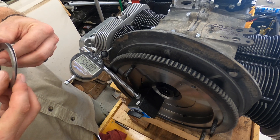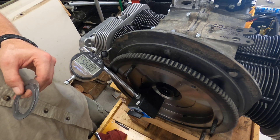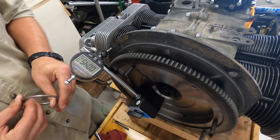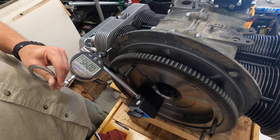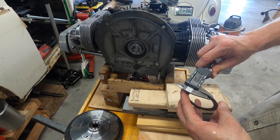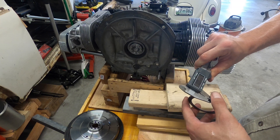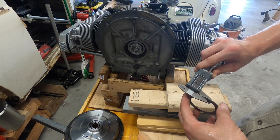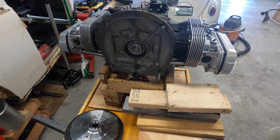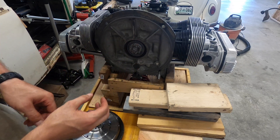I've always been told to use three shims. On the final assembly, make sure you lube the heck out of these things. I wouldn't use an assembly lube like this sticky stuff — for this one I'm gonna use motor assembly grease, it's not as sticky. I'm gonna take this back off, reverse my tool, and remove it. I've got my three shims at about 40 thousandths — depending on how hard I push I'm seeing 41.5 or 41.4 — so we'll go with this. I'm gonna go ahead and lube them up for a more accurate reading.